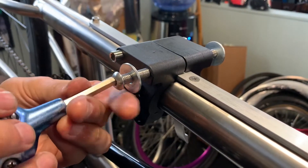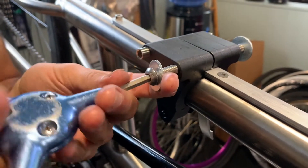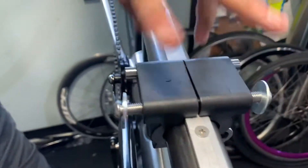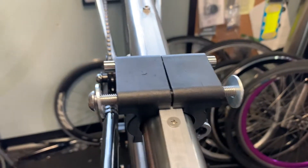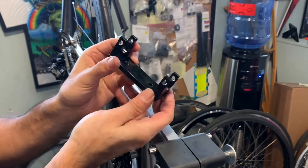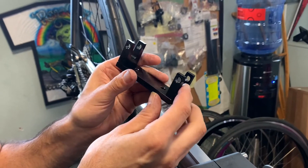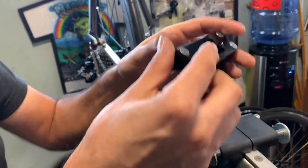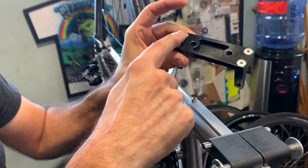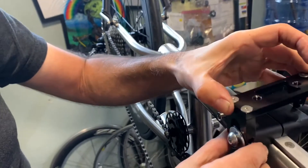This is going to thread in the same way, but the only difference is I'm going to leave a gap on both sides — that gap is for the seat mount. From the top, I have about a finger width on either side. The seat mount was designed for our clamp system, but these holes were not drilled far enough down, so we're making a couple of modifications. This is actually going to be a safer setup, and at some point I'll send you a perfect-fit piece.